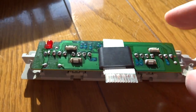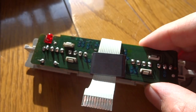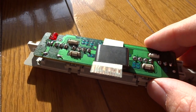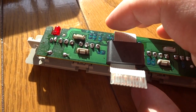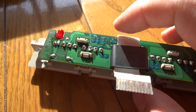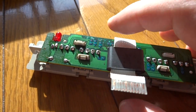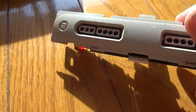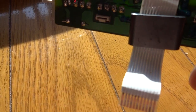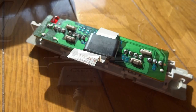As you can see here, we've got our fresh solder all the way down — we even have it under here on our connector. What we're gonna do is plug this thing in and give it a test. You can see up here it looks a little bit discolored, but I just kind of scraped away a little bit of the solder mask and everything seems to be intact. So instead of removing that right now, we'll just leave that on there — it's just discolored, still okay. We're gonna plug this thing in here and see how it goes.